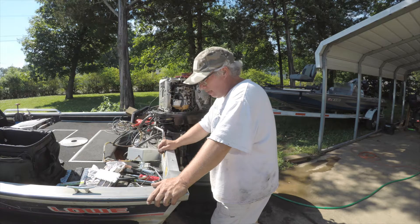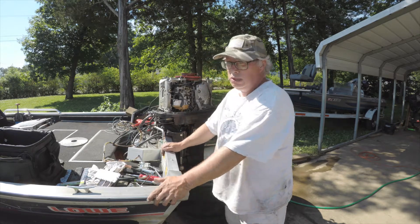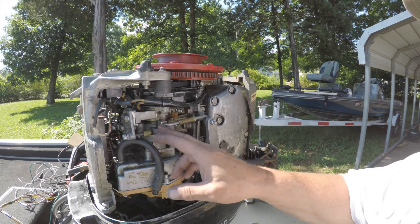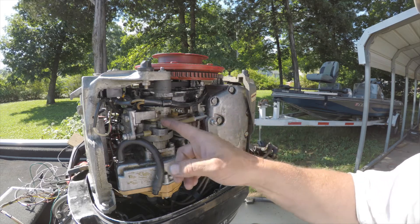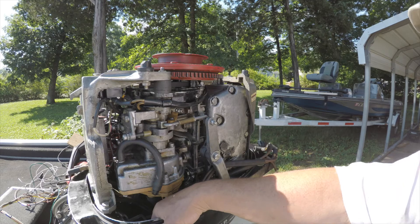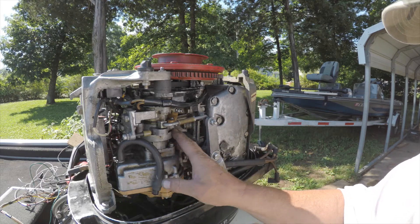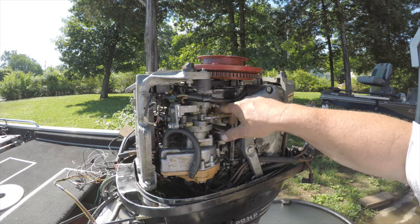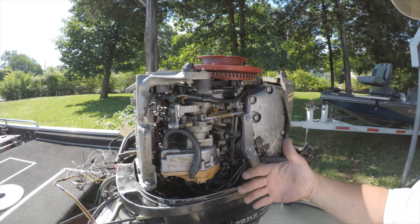The real big thing is it seems very arbitrary in the book. On all the old Johnsons and Evinrudes, they had a measurement as a guide to adjust this rod. On these 500 series, everything in line — and this one in particular — when you adjust the throttle cable, it adjusts this, and then it also adjusts your sync to the carburetors. There are two 5/16ths nuts on this plastic piece that adjust the carburetors, and there's a primary and a secondary pickup on them.